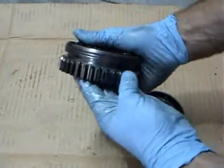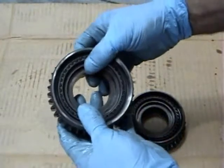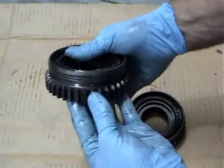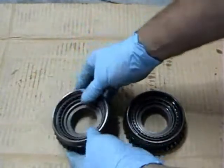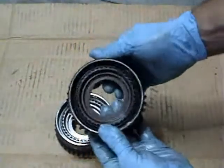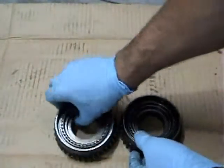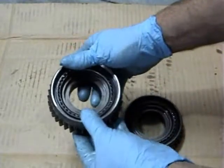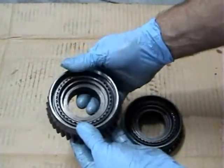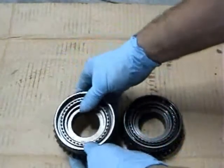This is $600 list just from the dealer. That's why these transmission repairs are so expensive. From what I've read, this replacement is a different material and has a little looser clearances, so you definitely want to replace it. You don't want to just try to free the old one up and file it down. On my own personal vehicle, I switched to this probably about 30,000 miles ago and about 150 quarter-mile passes, and I've had no problem with this new setup at all.